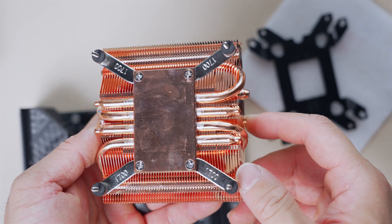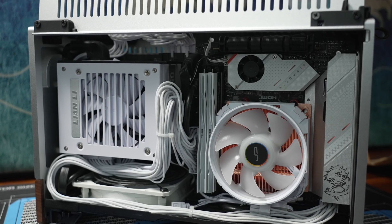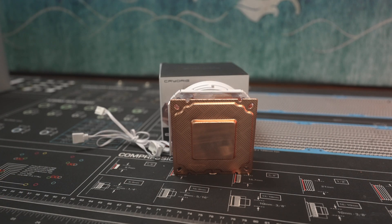At a minimum, the Thermal Right doesn't appear to lose out here, and given the higher market price for the C5 series coolers, it's really hard to justify since I don't see an objective gain over the conventional heatsink. I think this vapor chamber design plus a few heat pipes could potentially bring a small improvement — similar to what we're seeing with 5080 and 5090 GPU heatsinks — but you still need enough fan to make that work, and we're limited to 92mm here. If that addressed your questions, give a like, subscribe, and thanks for watching.